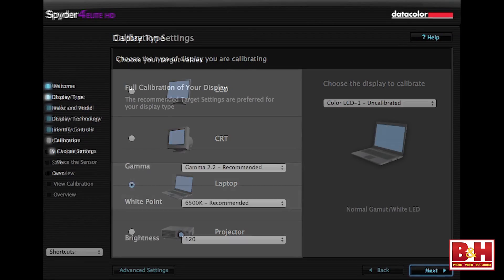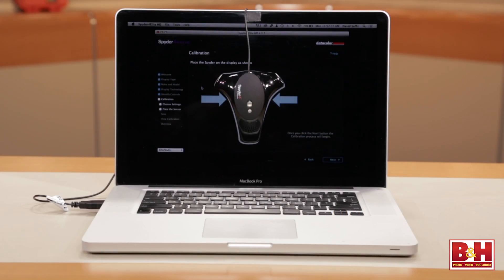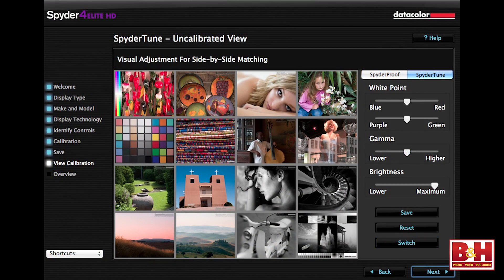It's a physical probe that you place flat against the screen. It has a lens on the back side. You attach it to the computer, run through the test patterns of the color patches, and the software reads the results and directs you in adjusting the device. Now, there's a difference between calibrating a computer display and a video display: the computer-driven display is controlled by the graphics card inside the computer, whereas the video or reference display is controlled by the internals of the display itself. When calibrating a computer display, you're working through the Spyder software to write a profile to the video card; with a video reference display, you're using the buttons on the display to adjust its parameters.